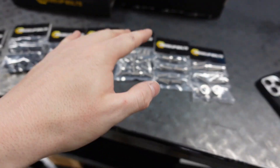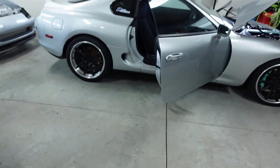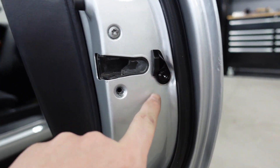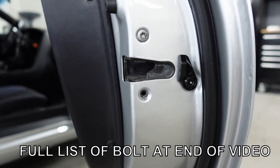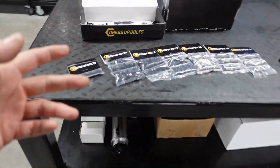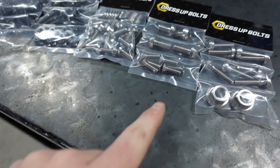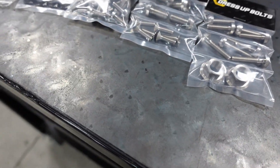The reason for raw titanium is a lot of it's going to go on the body, and I didn't think black bolts on a silver car looked right — it just stood out and didn't look proper. So I wanted some normal titanium parts. Some of this stuff's going in the door too. I'm replacing everything. I'm going to show you inside the gas cap. Right now I'm replacing this — I've already got one bolt in there. These are M8 by 1.25, and then these two I'm going to use recessed bolts that'll sit flush, body color matched.